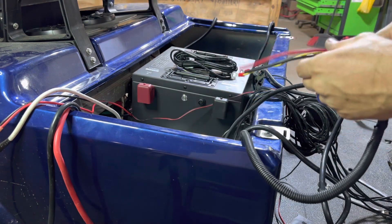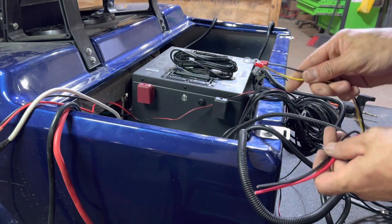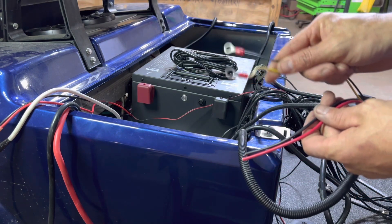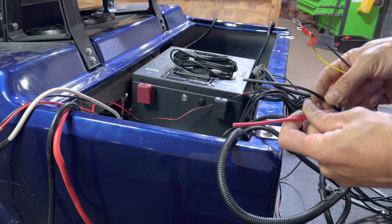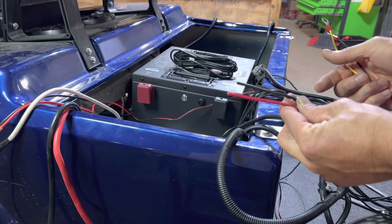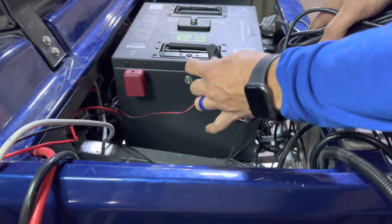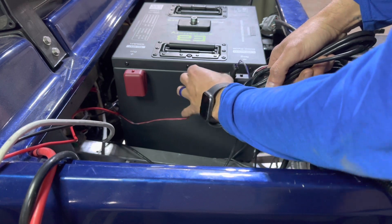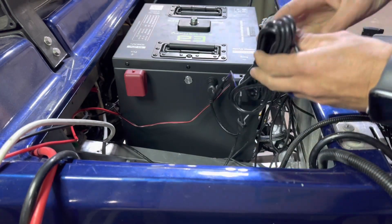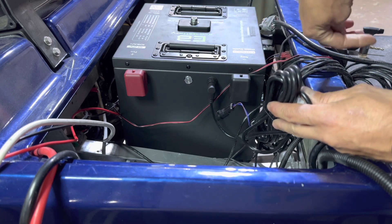In regards to the rest of the 12-volt reducer wiring harness: the small black and yellow wires with the eyelets on them are going to go to our 48-volt supply — so they go to our battery bank. The black and red without the eyelets is your 12-volt supply. Go ahead and plug up your voltage meter wiring harness — it only goes in one place. There's a communication port right here on the battery. Screw it down.